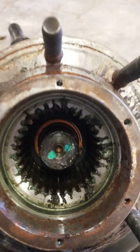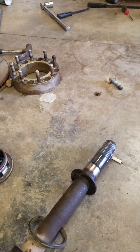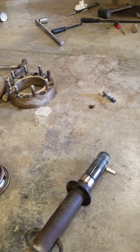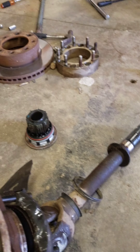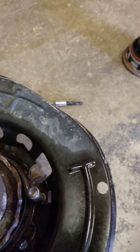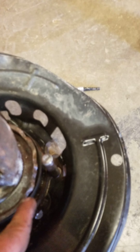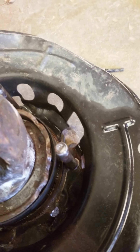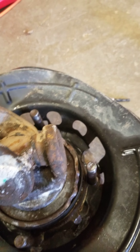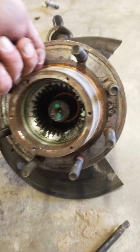There is a way around it. Even if you take that ring off, you're still going to get your hub off, and then you still have to try to beat this whole assembly out of the knuckle. What I did was I took a three-eighths ratchet extension, about a foot long, and got in behind it and hit on this seal — this one right here.